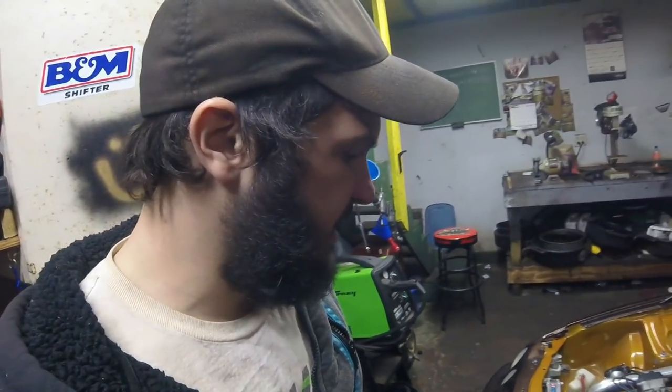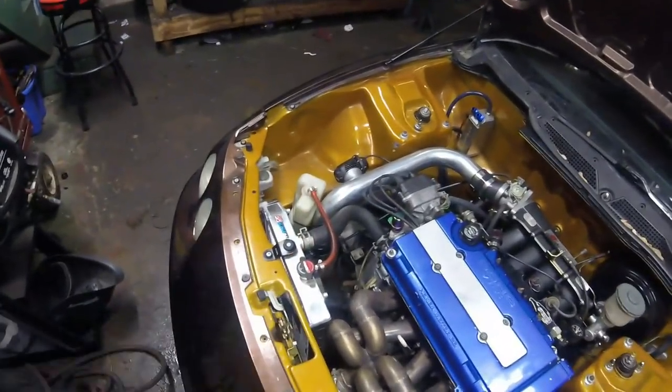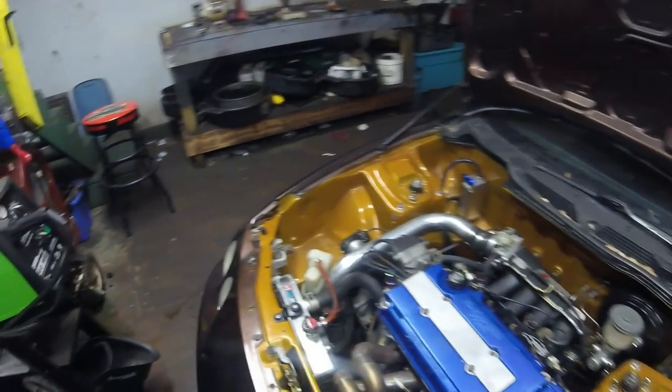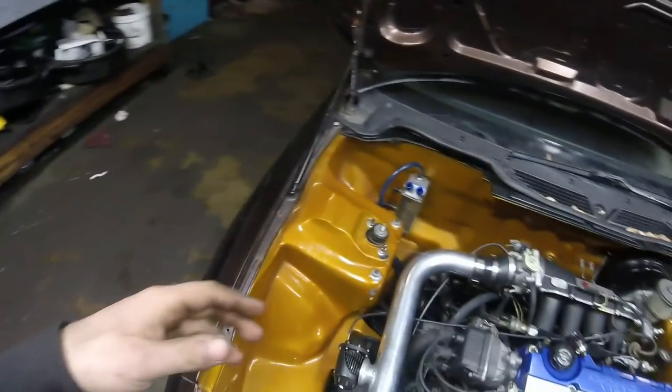Hopefully you enjoyed this headache of a mess of a car, but damn it turned out great. I'm super happy with how this came out — everything seems to be working very well. No real issues other than the head gasket leak and the heater kind of sucks. I think the heater core is a little plugged up or the thermostat is a little sticky because the lower hose doesn't get that warm. The car doesn't overheat, it just seems to be lazily cycling coolant through the thermostat. Probably just needs a thermostat replacement.